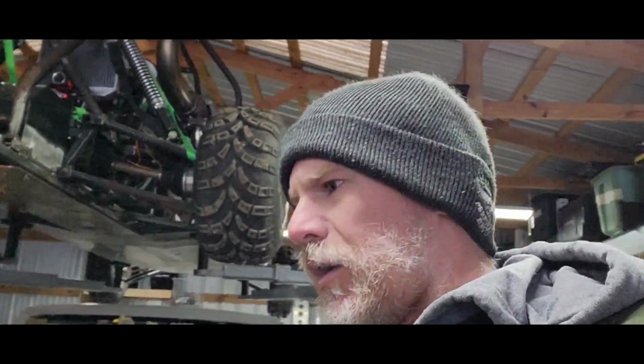The fender is on, all of the hardware is in place. I put our front grill support, or our valance, fascia, whatever you want to call it, in there, and it's tightened up against the fenders. I kind of needed it to bring both of the fenders together. It really helps with how it lines up with the door itself, because if it falls in, it kind of bows the edge of the fender out next to the door. So I put the valance in there, and it brought that back to where it's supposed to go. And it is really neat looking at this truck, seeing the fenders back on it, seeing the hood on it, seeing the valance on it.